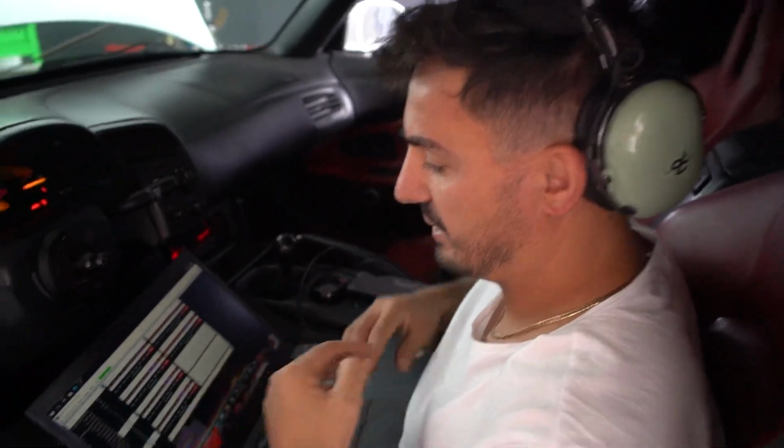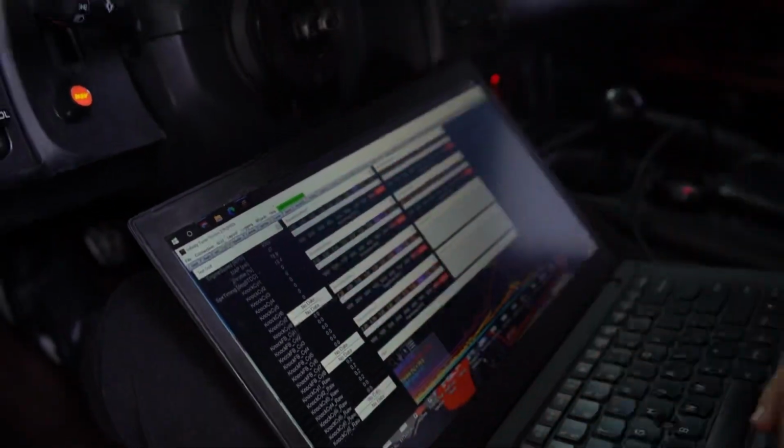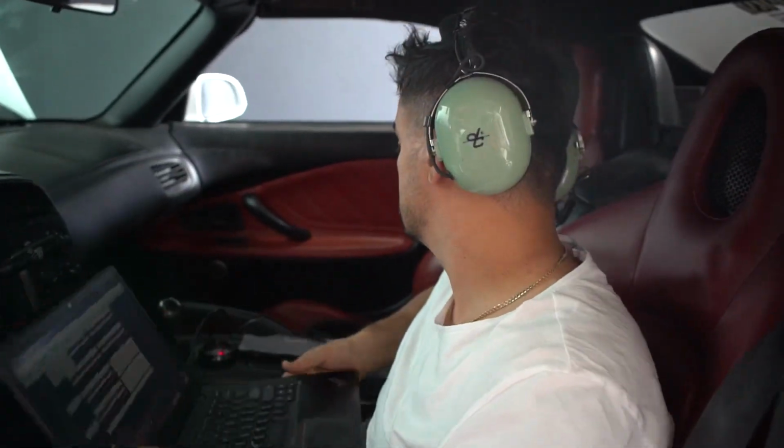And you can see now my knock threshold went up a little bit more, but I'm still way below the knock threshold. So it's got a little bit more timing left in it, but I'm going to throw more boost at it and then at the end give it a little bit more timing, see if I can squeeze it in. But let's check everything on it real quick before we start getting into high boost.